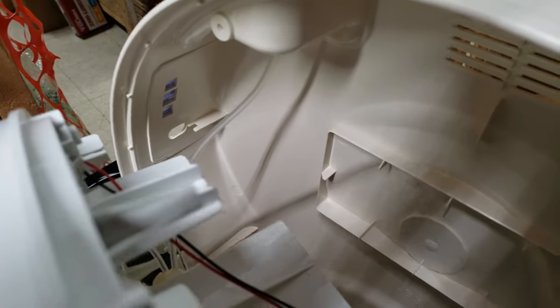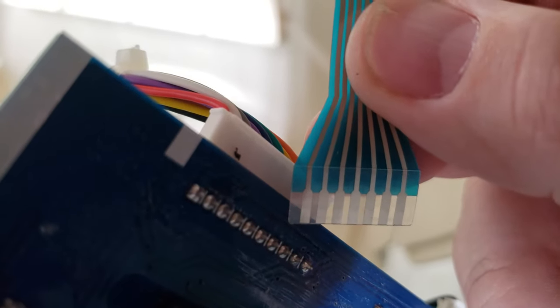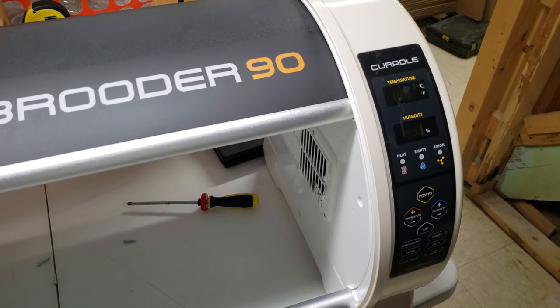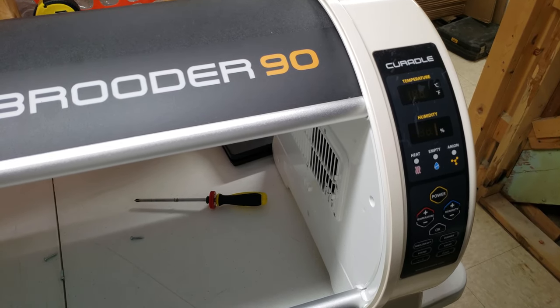Make sure to reconnect the water tubing properly first as you put the side panel on. And the membrane ribbon, make sure not to twist it. The membrane should be with the lighter colors up and the darker colors facing the back. Reinstall that properly. Securely fasten the side panel back and test the unit prior to reinstalling the screws.